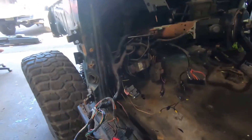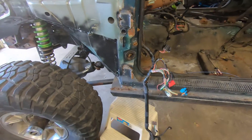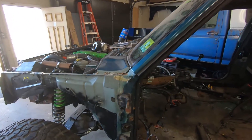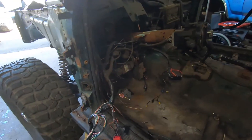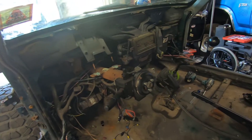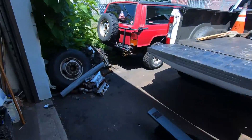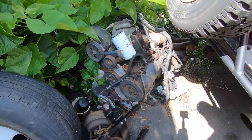This is a '96, and for some reason Jeep decided — for one year only — to do all the wiring colors differently. Older than '96 is different, newer than '96 is different. Even though '96 and up shares the same basic computer, all the connectors and colors are different. So we're going to wire it ourselves and take parts and pieces off of a 2000/2001 Cherokee 4.0 we have here. It's got a ton of wires and pigtails to make it easier to patch into the MegaSquirt system.